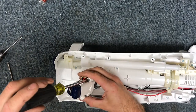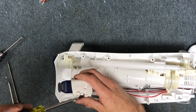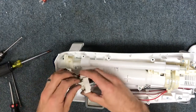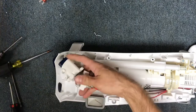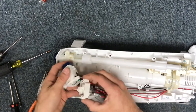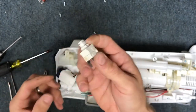Now we can actually pull the switch assembly out. You have two screws — and you can see it's burned, so this switch has failed. Remove the two screws and then grab the terminals pretty firmly because they have little clips on them and don't just pull out easily.